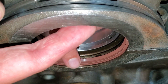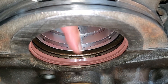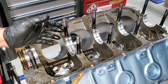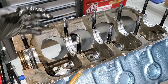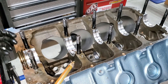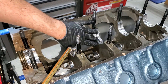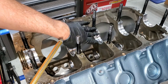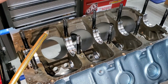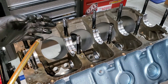You can also take calipers and measure the ID and then measure your journal — you want about 20 thou overlap. I'm good to go to the next step. Time to test fit the crank. The reason I'm test fitting it is we had the crank reground and blueprinted the bearings, so we need to make sure there's no binding. If there's binding, we have to go back to the machine shop. I'm putting motor oil on the bearing surfaces, coating the journals, putting the caps on fully torqued, and we'll see how it behaves.